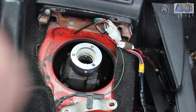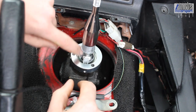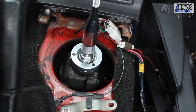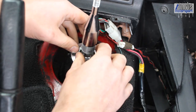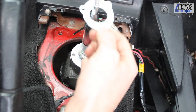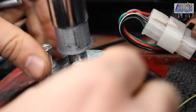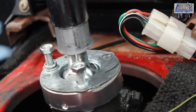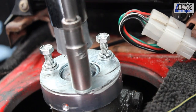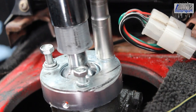With that in place we can then install our new short shifter. Note the little cutout in the ball will line up with the nugget on our large spacer. On top of our shifter goes the plastic bushing included with the kit — this will fit tightly over the top of the shifter ball. Then the last thing we need to do is bolt down the top cover. When installing the new bolts, only hand tighten them — don't torque them down super tight. These just need to be snug; you don't want to damage your shifter or more importantly the gearbox.